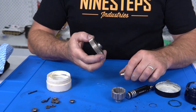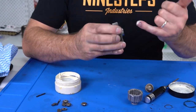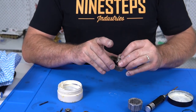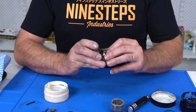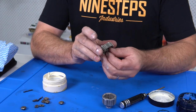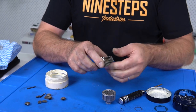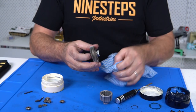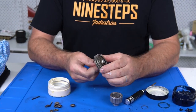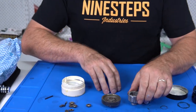I don't have to put the bearings on now — on most other cars you'd put bearings on the cases first before the out-drives go in, but Traxxas have designed it so they go on last, which is a nice touch. I've got my 2 million weight oil here — 2 million CST oil — and it's quite tricky to deal with. When working with really heavy oils I like to put it in a little piece at a time, because you're effectively packing the diff unit. I'm doing such a good job on this diff because I know how much abuse and punishment it's going to take.